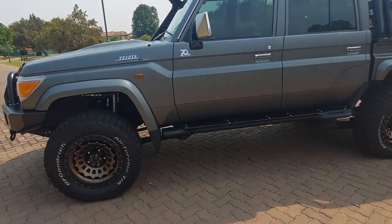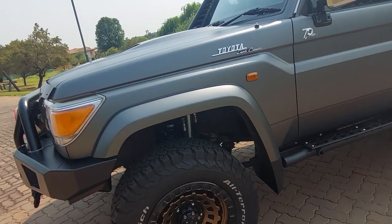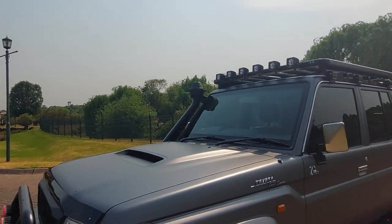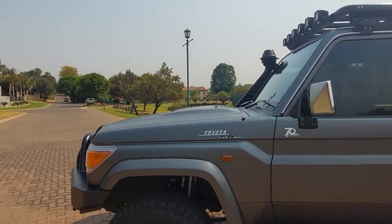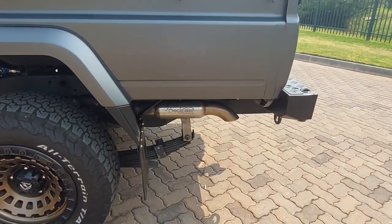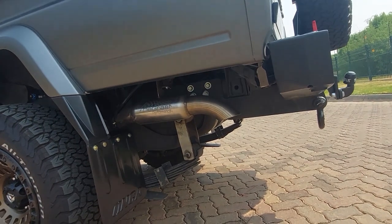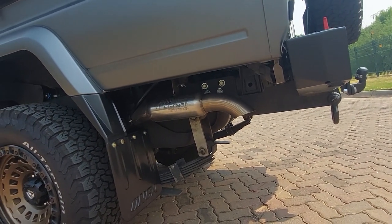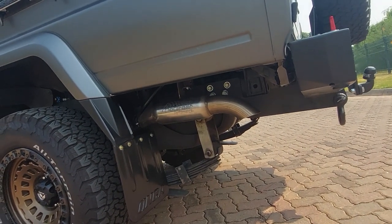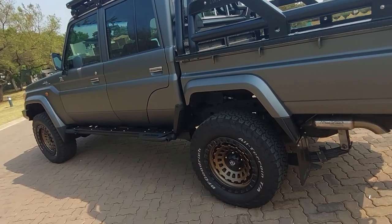It's had an additional power upgrade with a heavy duty clutch installed rated at 1,300 Newton meters. Second and fifth gear have been widened so it's a bit more daily drivable. The snorkel has also been modded so air goes from the snorkel into the engine, power comes to the wheels, and air exits through a 76 millimeter downpipe installed straight from the turbo — so basically air flows a lot easier than stock.